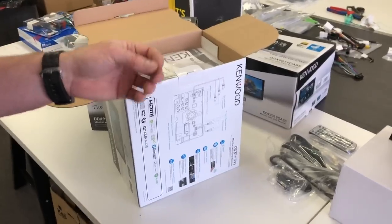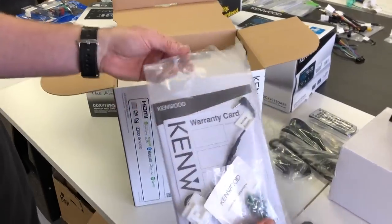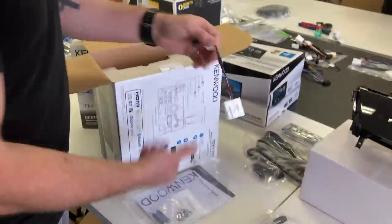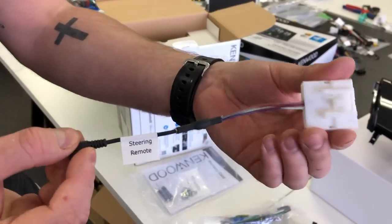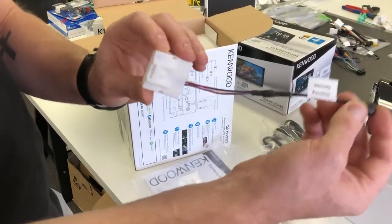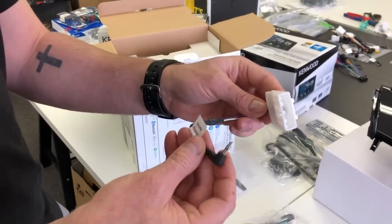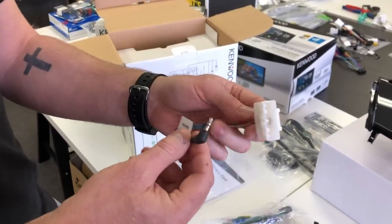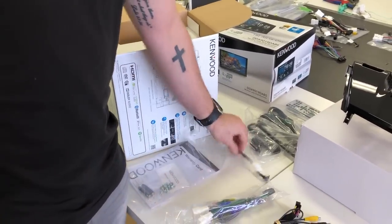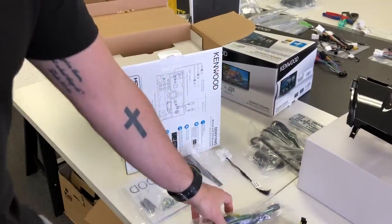Also included is an external stereo microphone for extra clear talking, with sensitivity adjustable on screen so you can get a high-quality call. On a lot of Toyotas they had built-in mics that weren't very clear, so this will fix that issue. Also included is an instruction manual, some screws, batteries for the remote, and a standard steering wheel control adapter — a 28-pin plug that will do steering wheel controls for a lot of Toyotas, pretty much from 2013-2014 onwards. The Kenwood unit has built-in steering wheel control programming. We do custom harnesses on our website for all vehicles.